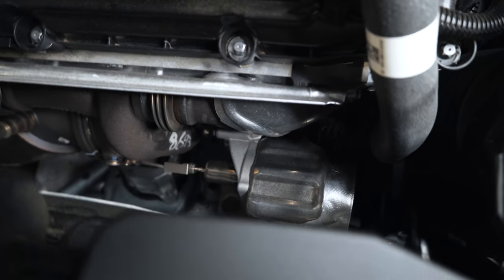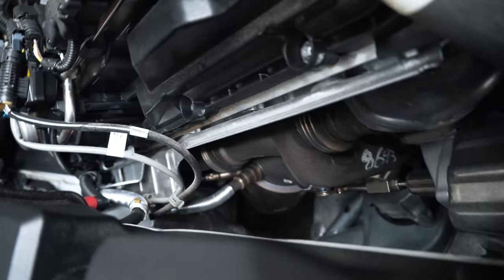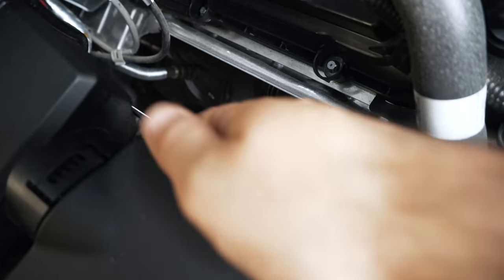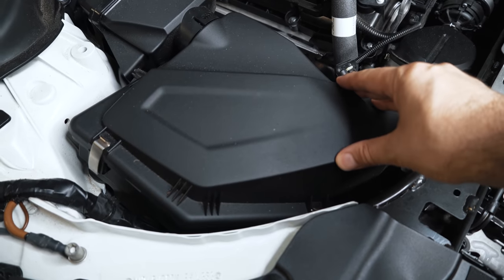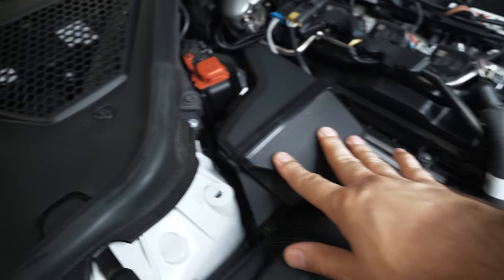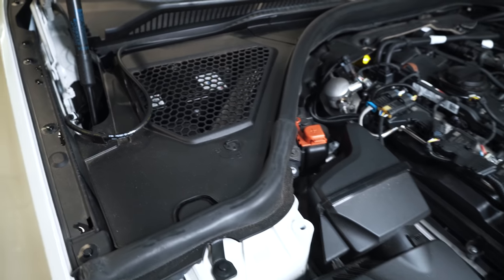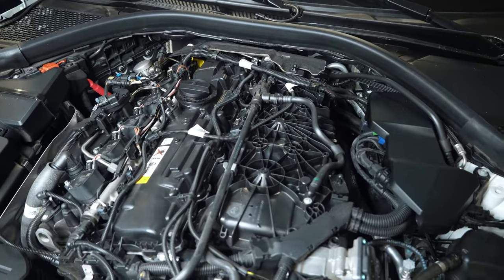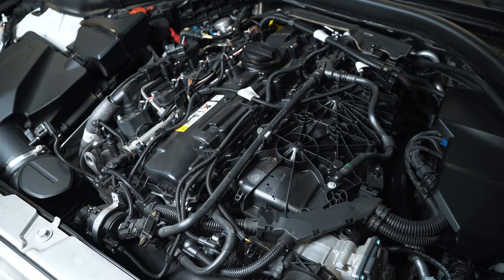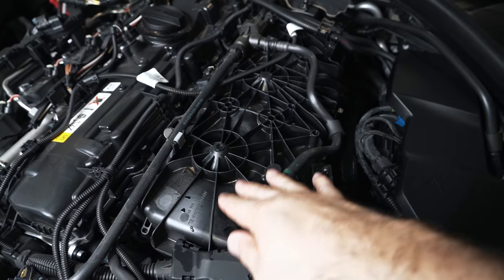There's a look at the turbocharger — you can see the wastegate adjustment arm, it's electronically controlled — and you can see the primary and secondary O2 sensors. There's plenty of space between the engine for cooling purposes. The motor mount down there looks pretty robust and that looks to be a decent sized turbo. There's the intake air box with a pretty decent sized resonator. Down in there is a lithium battery for flash programming and accessories, and there's also an AGM battery in the trunk. This car now runs Valvetronic.